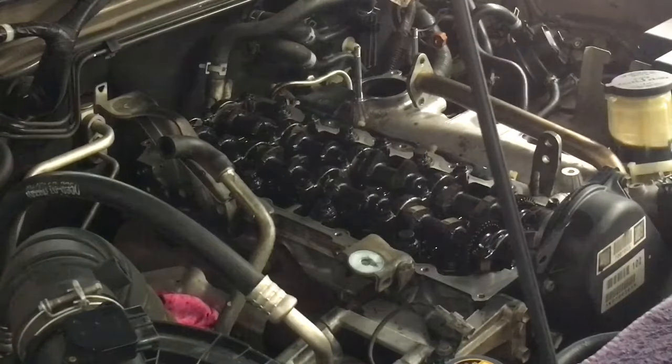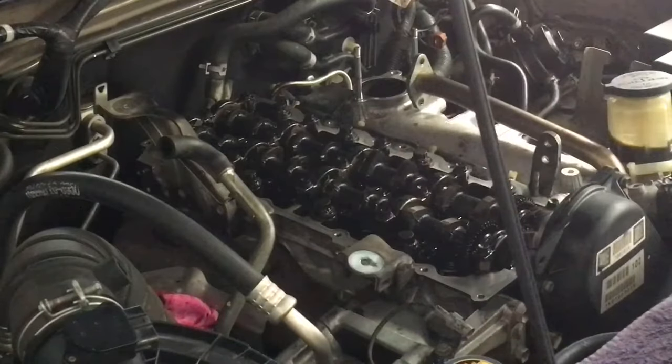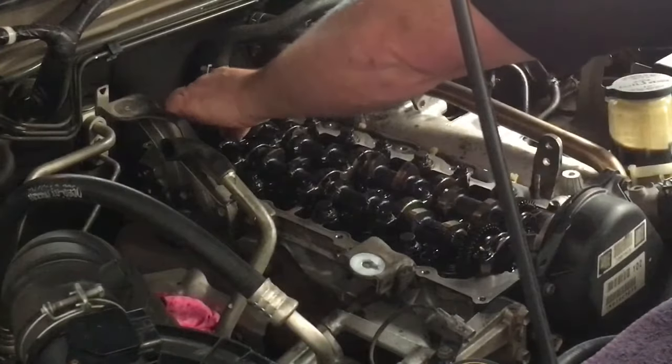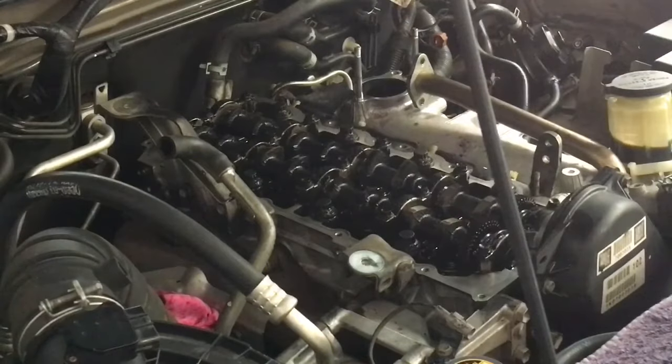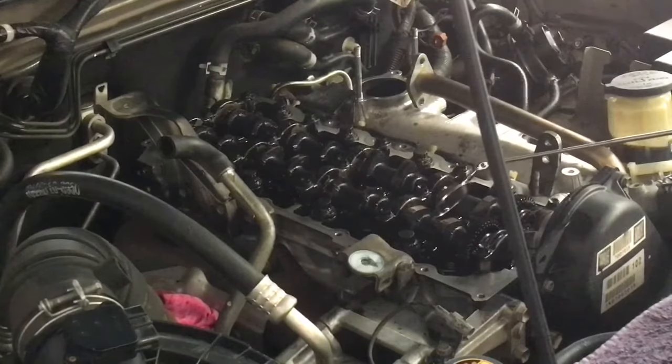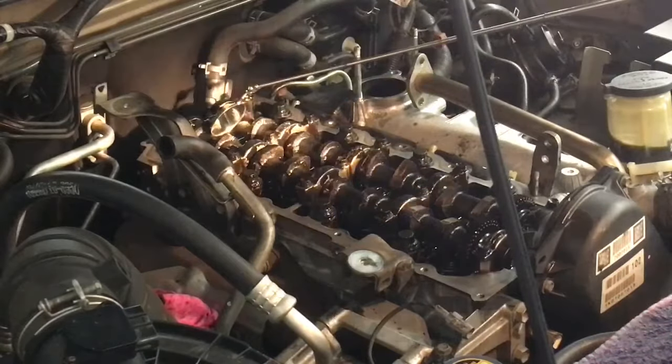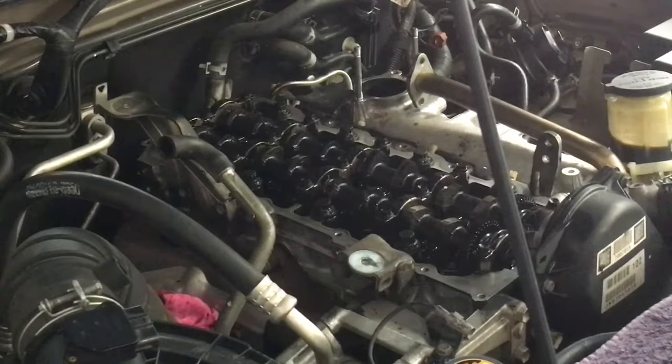So these seats I was talking about earlier, they are still copper. They've just got a coating over them. Some of the coatings on the genuine ones make them look like alloy, and some make them look like they're chrome of some sort. So just drop them down there dry, that's the Toyota procedure. If you bury them in a diesel, you might want to put a whole heap of goopy anti-seize on it, and that's fine if you want to do that.